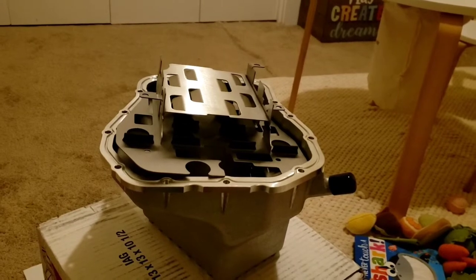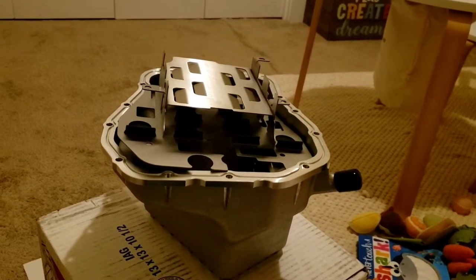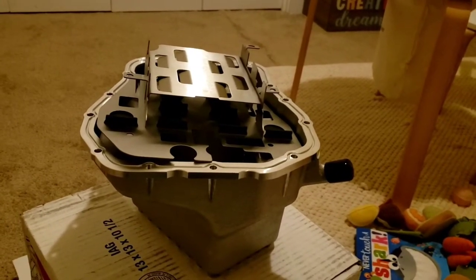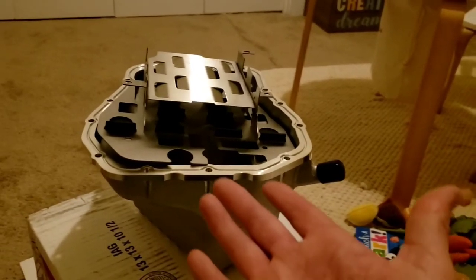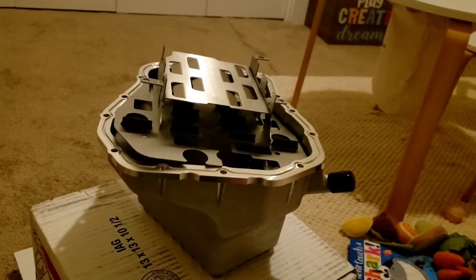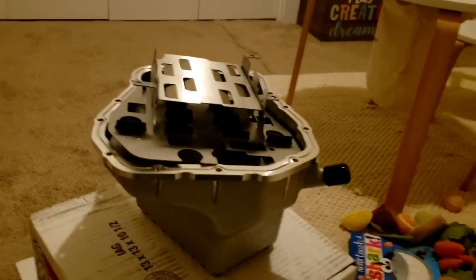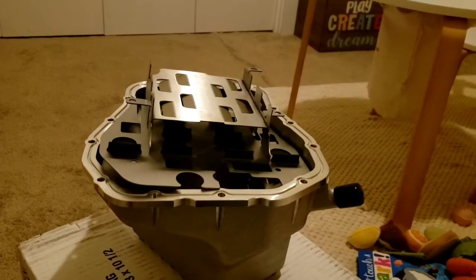But in these motors, your crank doesn't actually splash through a bath of oil or anything like in a Honda or an Evo. So knife edging it wouldn't do shit. But I guess this is the same theory, trying to keep all the engine oil off the crank so it keeps higher engine RPMs and keeps you from damaging things.